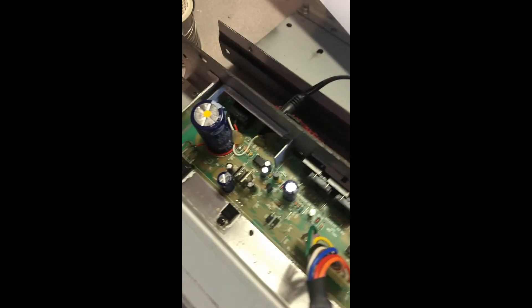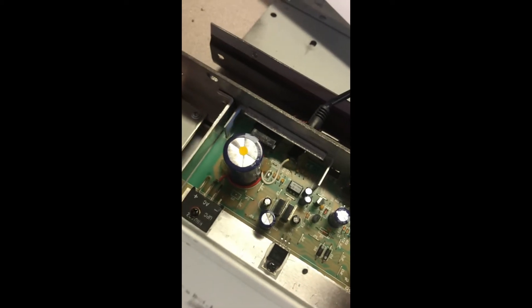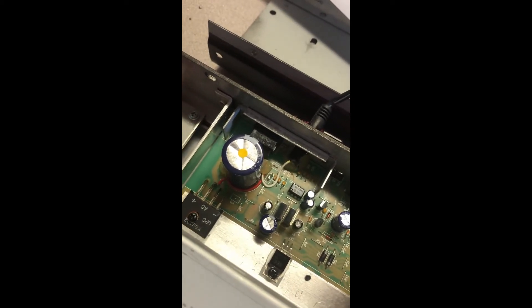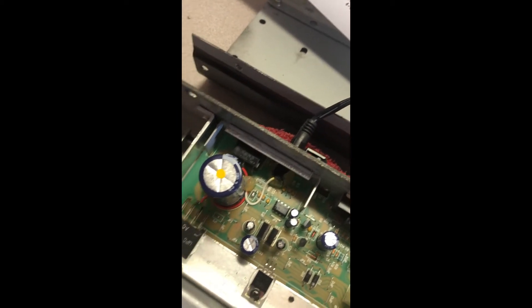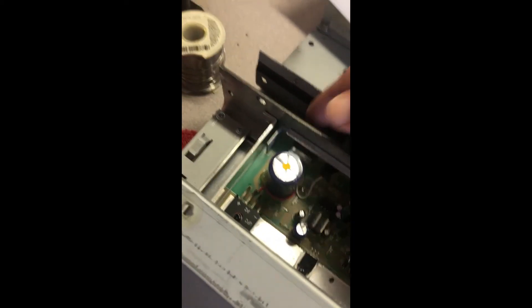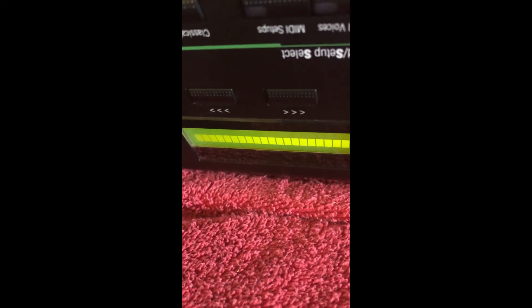With the ground now intact, the voltage has actually increased slightly. I'm now measuring about 4.4 volts on the right pin and about 9 volts on the left pin. However, I'm still getting the same symptom — turning the screen back on with ground junction 302 hooked up, I can still see the black bar. I'll try a reset to see if that clears it.